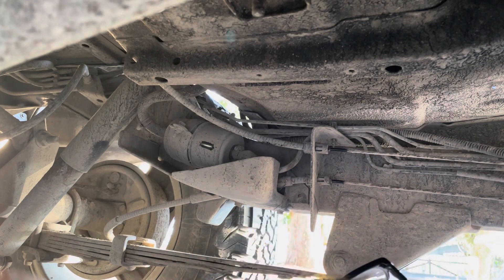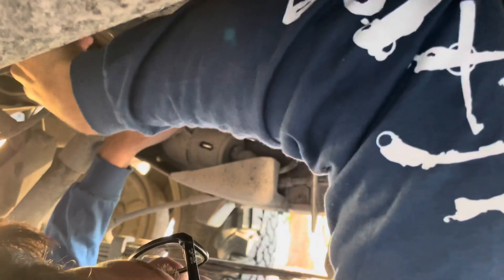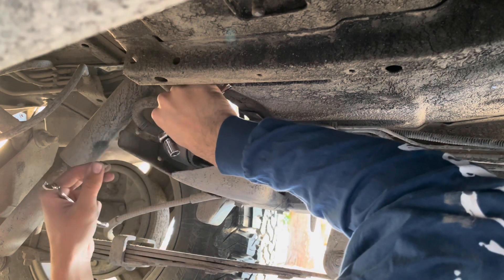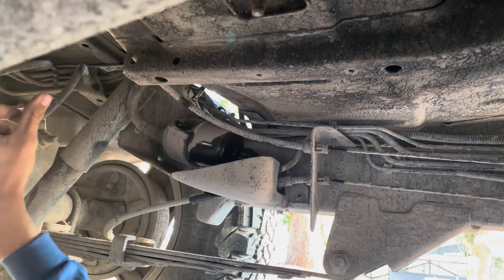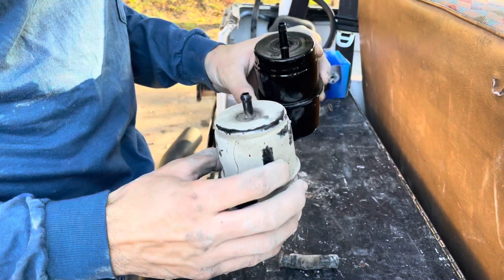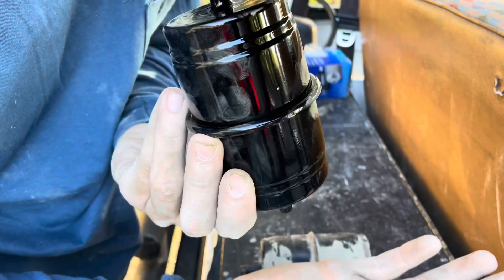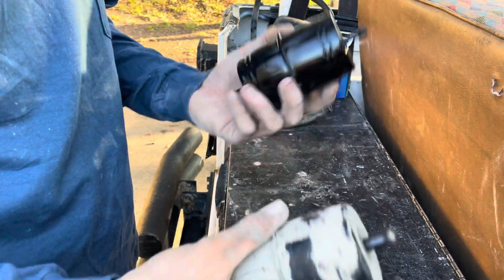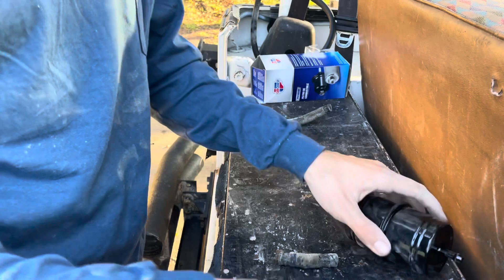I don't know how well you can see me but bear with me. I'm gonna start off by taking this one off first. See - if we wouldn't have released the fuel pressure it would have been a lot worse than that. This is the old filter next to the new filter. This thing is really clogged - I tried blowing into it and barely any air came out the other side. I'm hoping once I change out the old filter with the new one that there's nothing in the tank that's gonna clog up the new one. Someone must have put something in the tank and clogged up this filter.